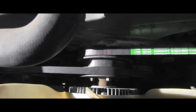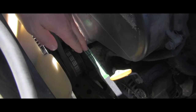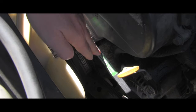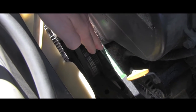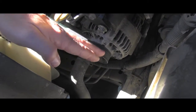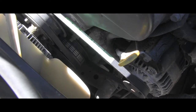Here you can see two of those V-belts out of three which are on this Toyota 5VZ-FE engine. The question is how do we put correct tension on each of those belts? Obviously, when they are not tight enough they will be squeaking and not working correctly. But if you over-tighten them, you will put too much load on, for example, the alternator, and you will probably be damaging the bearings on the alternator. So you cannot just over-tighten it.